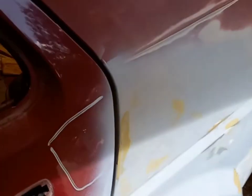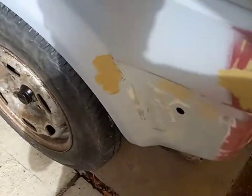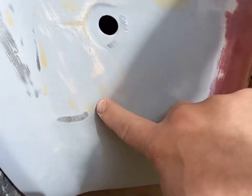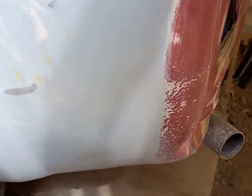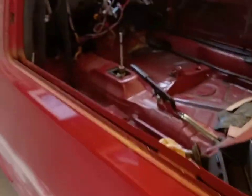So here we are. The new arch is fitted and almost done now with the filler work — there's just a little bit more to finish down there. This was a big bumper panel that had two holes in it. I welded a square in there, then filled it and played around with the filler to get the natural look. Am I happy with it? I think I could do it better, but it's going to be under the bumper so you're not going to see it. I'm happy with the result. All the glass is out.